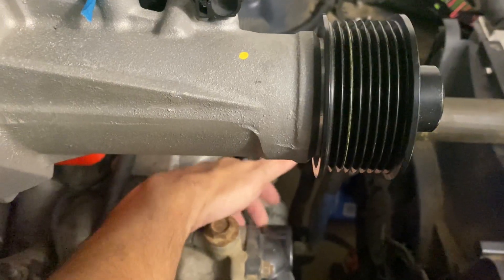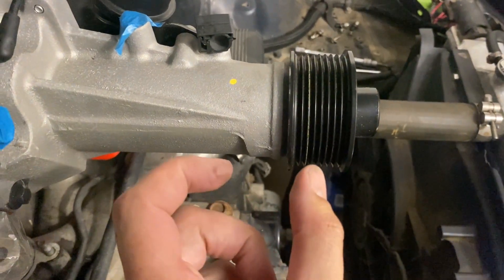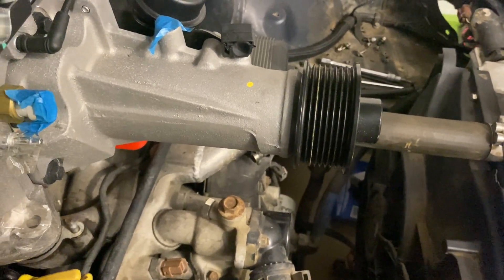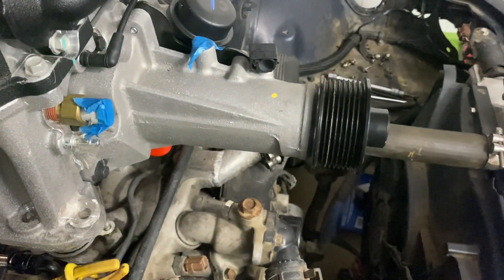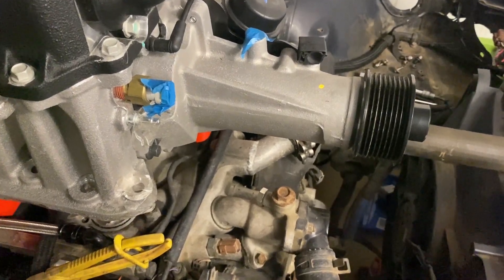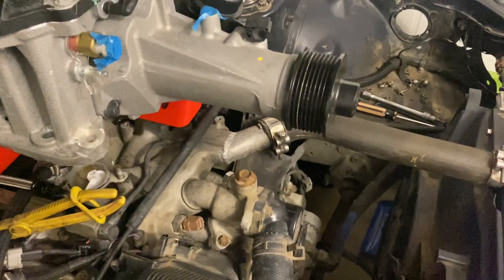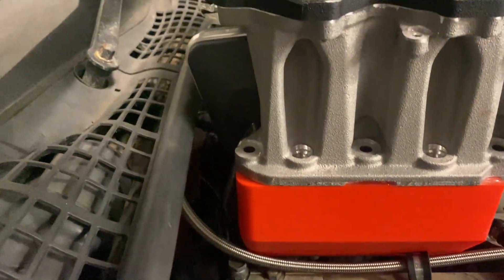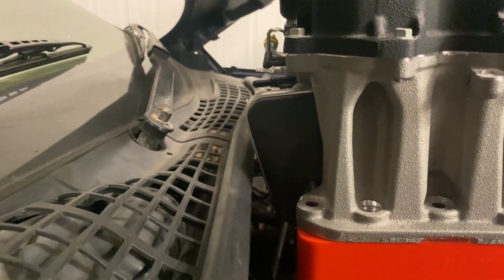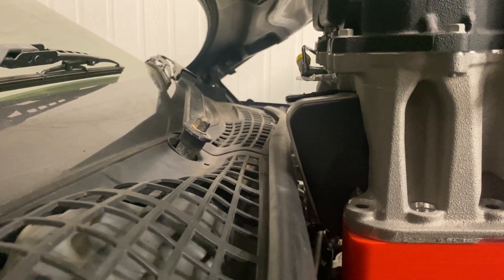You can see down there the idler pulley that returns up around the M90 — it's probably a good inch to inch and a half away from the supercharger pulley. That basically means the snout would have to get shortened to make all that work, so that's another hurdle. Belt routing aside, the clearance for the firewall is pretty tight. That electric motor for the drive-by-wire throttle would come right onto the bonnet seal — not ideal, but you could get away with it if you wanted.